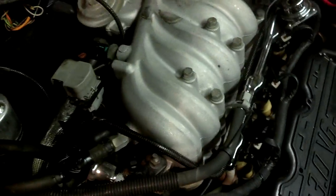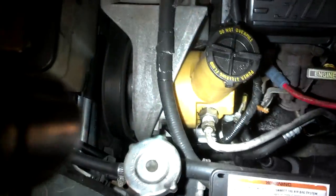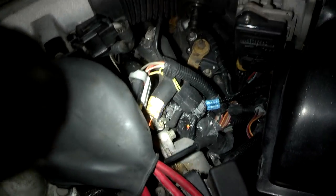Now the project that we are working on is a 92 Ford Taurus — great car, has a 3.0 motor in it. However, the power steering configuration is kind of weird because it comes from here, down below the motor, over, around the transaxle, back, and then it curves around and goes into the power steering rack, or the rack and pinion. So we are going to crawl up in here and take a look at this thing.